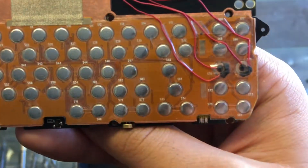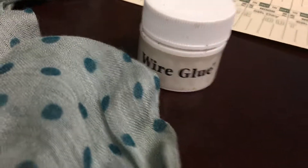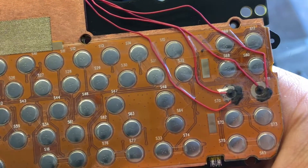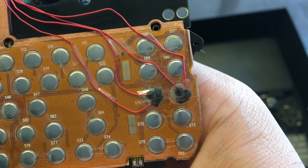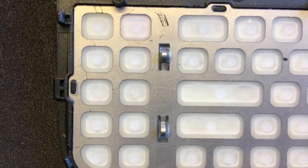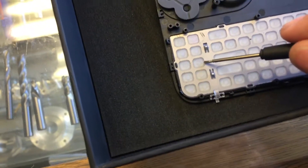That's pretty much it. I just use the wire glue — it's actually this stuff right there. That stuff. It actually works, but you have to be very careful. It actually didn't work one of the times — I glued it in and then it came off. So that's why I put the tape over that, so it could cover it. And also on the keyboard itself, I actually shaved down the middle ones right there — those little rubber things. Those are the ones I shaved down.